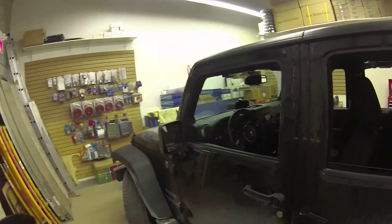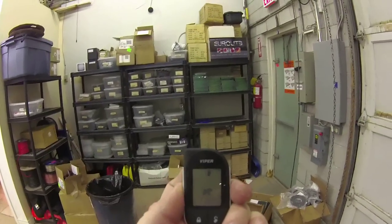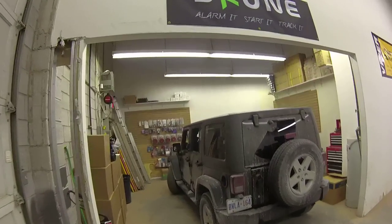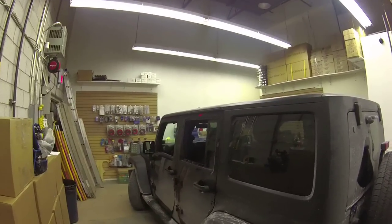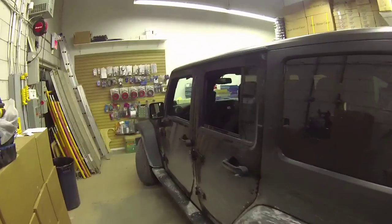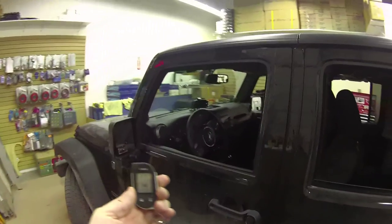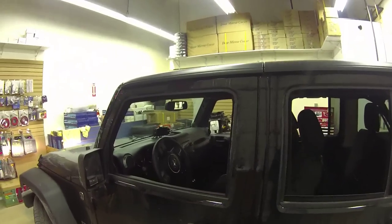Now what that was right there was the field disturbance sensor. I've actually set it up so that when the proximity slash field disturbance sensor goes off, it shows on the actual remote control. It triggered because I walked up next to the vehicle. The reason the customer wanted this was because in the summertime the hard top comes off, as do the doors — he enjoys this vehicle for cruising around in hot weather with no doors and no roof. As you can see, the sensor is a little bit sensitive and I do have to do some adjustments, but if I stick my hand in here and move it around, the alarm triggers and it tells me 'field disturbance sensor.' If I hit the unlock button, that silences the alarm and turns it off.